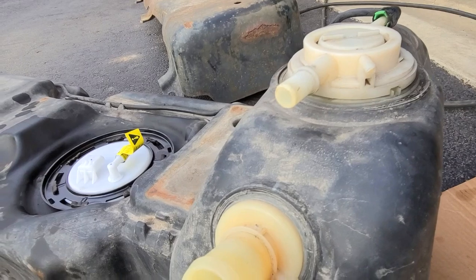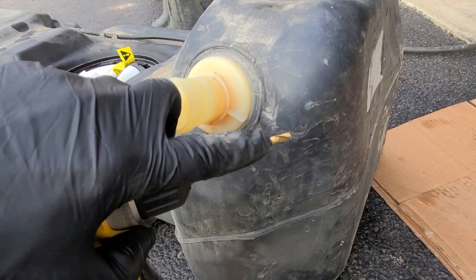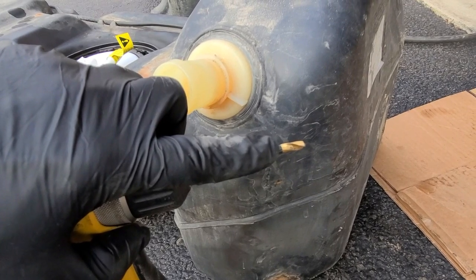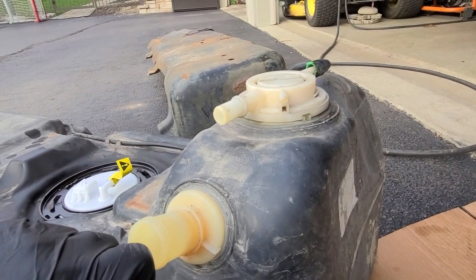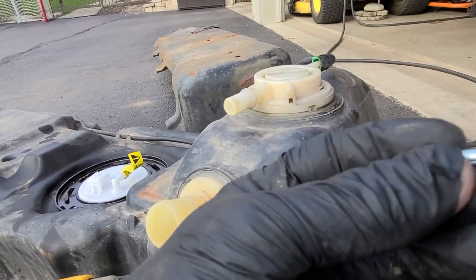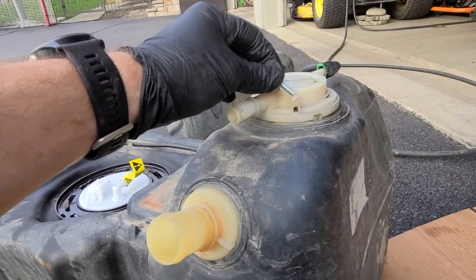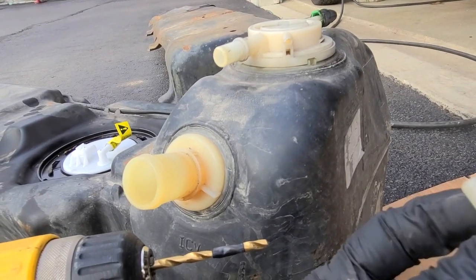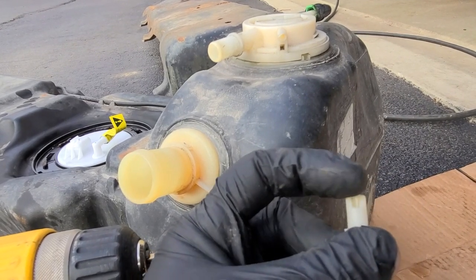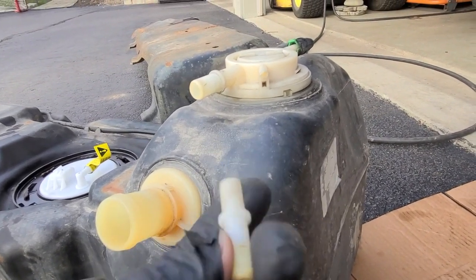So what we're gonna do is take a 13/64 drill bit, I set it to a depth of about half of the length of that pin, which is about half of an inch. The pin's an inch. So we're gonna drill very carefully into there at that depth, which will give it a backstop so that this thing doesn't push all the way through and end up inside of here. So we're gonna drill half inch into there, and then similarly half inch into here to create a tighter connection point. And then we'll basically just epoxy these two parts together. So pretty easy, and I'll be back with the finished product.